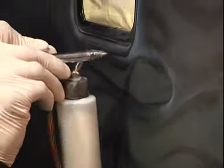Want to add a nice large highlight area, just keep dusting the pearl over it. Don't lay it down heavy. It'll gradually accumulate. You don't want to have everything the same evenness because it'll look too thin. As much contrast as possible, not all in one area.